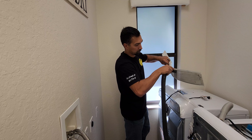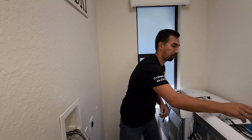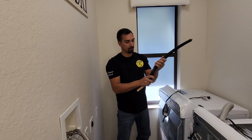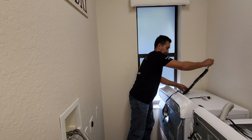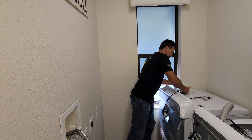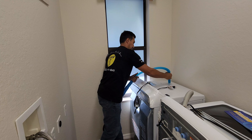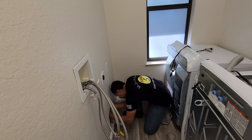Next, take out your lint trap and vacuum it on both sides. Then put the attachment with a narrower outlet onto your shop vac so you can put that down into the lint trap tray area. Also get your bristle brush and put it down into that area, moving it all around — up and down, all different motions — to knock off all that lint and debris clinging to the side of the dryer drum. While you do that, go ahead and vacuum it out. Once this step is done, also vacuum the dryer vent outlet on the bottom of your dryer, because whatever didn't get sucked up is going to be sitting down on the ground.